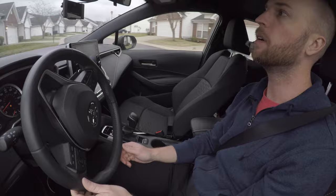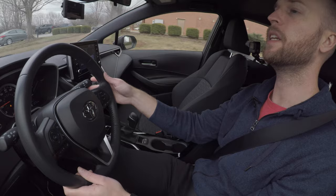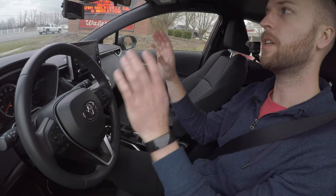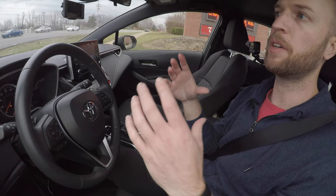So when it's calibrating, it's getting an orientation and trying to compensate for any irregularities in the mounting position. If it's a little bit off-centered or a little bit to the side, it's going to readjust the model frame to center it so that every car has, you know, a leveled, centered model frame, as best as possible.